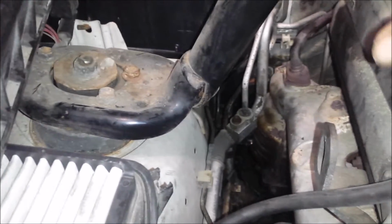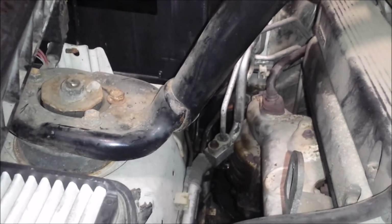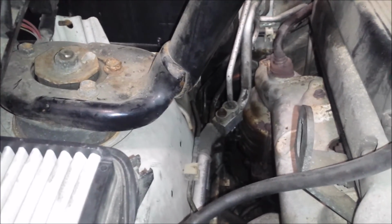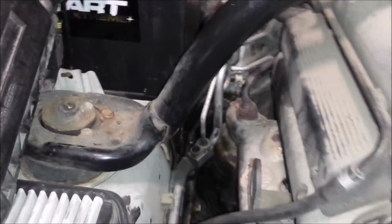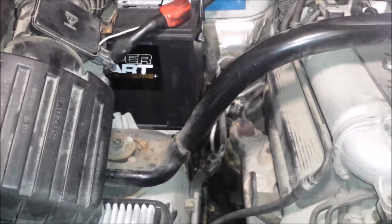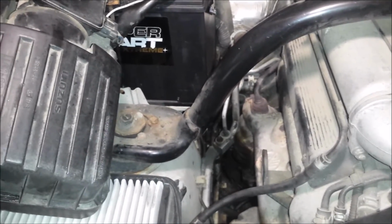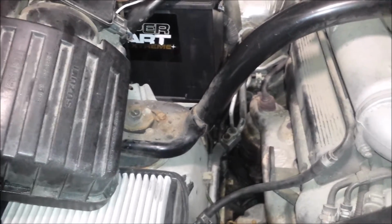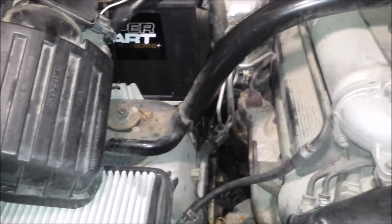Do away with the block, run new brake lines from the connectors. Underneath the car, we have room to work, run them back over into the main block. So, that is an option. And it probably costs just about the same as replacing both those pieces. So, again, brake part, I got it from O'Reilly's. The number on it was, let's see here, BH620569. And those are O'Reilly's where I got that. And it was actually for a 2004 model they found, so it works. It's the same thing.